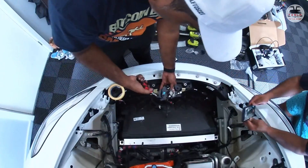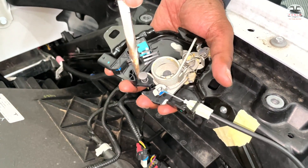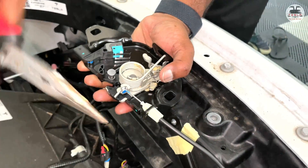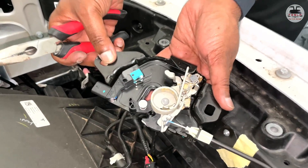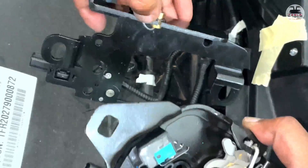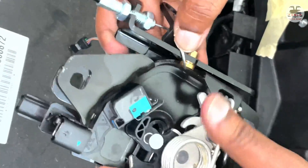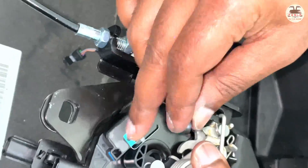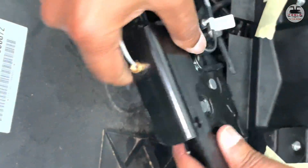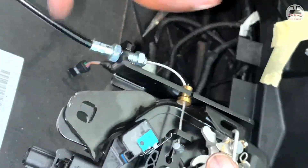The next step involves a large spring in the lock mechanism. The spring has a short arm and a long arm — unhook the short arm. Then bring the lock bracket and motor from the EV offer box, align the lock, and there is a drawstring that falls in place. Pull it and hook it onto the small tab where the spring was. The drawstring doesn't stay in place easily, so hold it with both hands, then replace the short arm of the spring back onto its original position.